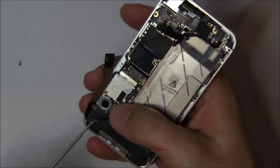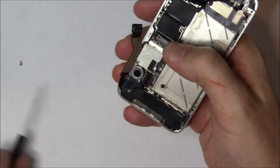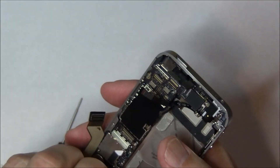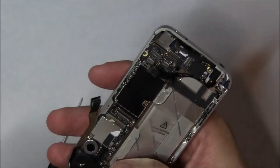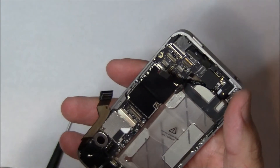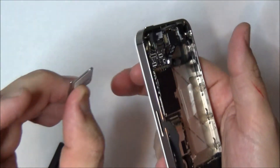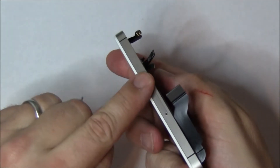There's a screw that goes in over the top of the vibration motor, and the last screw is again a flat bladed screw that goes in the bottom right. Now we're going to test it by sticking in the SIM card tray and making sure it sits flush. If it gaps at all or doesn't want to sit in there, then it's not in properly. We're okay here, so now we're going to reconnect all the cables.